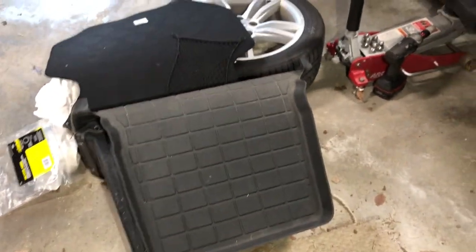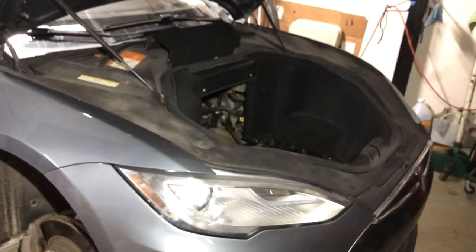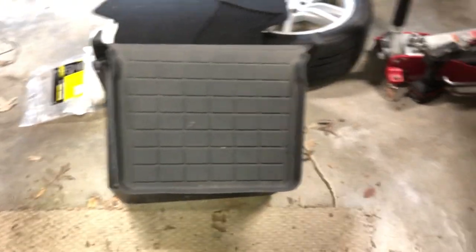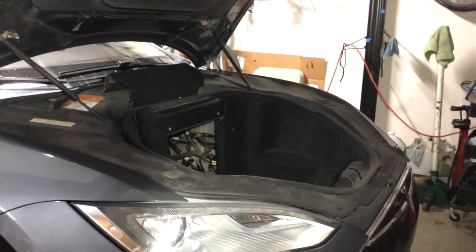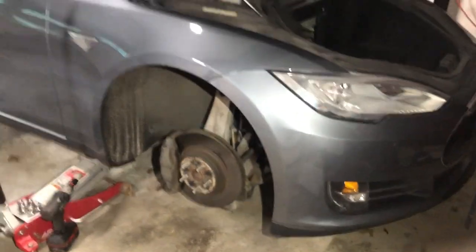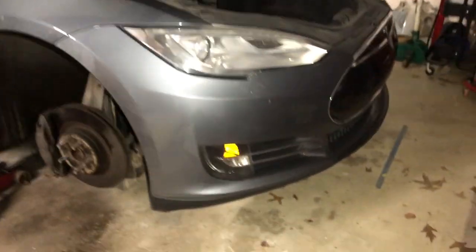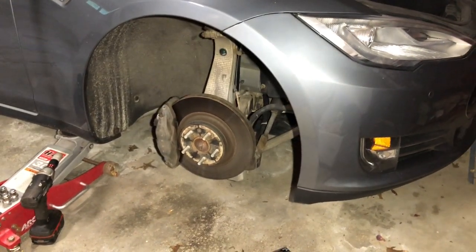You really don't need to see me put this all back together since I told you how I took it apart. Basically: wheel on, jack down, put in the front box with 10-millimeter screws — making sure the ones with screw-on posts go where the cargo net is — then put in the carpet, the rubber mat, the cargo net, and then that trim piece on top wraps around the beam and we're good to go. That's how you work your way around the condensation problem that has been ruining a number of these batteries. And now at least I know where the puddle on my floor will be. Thanks for watching.